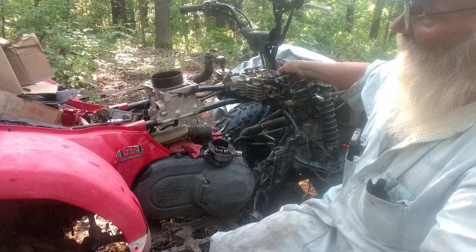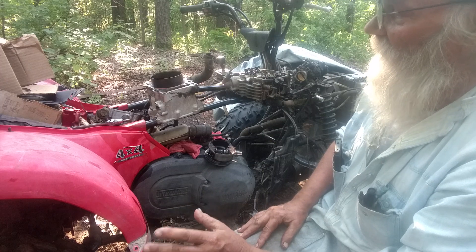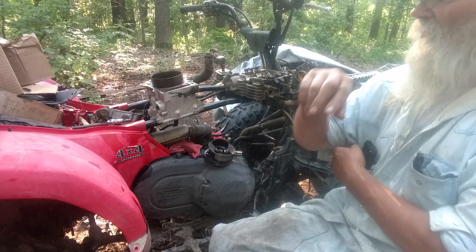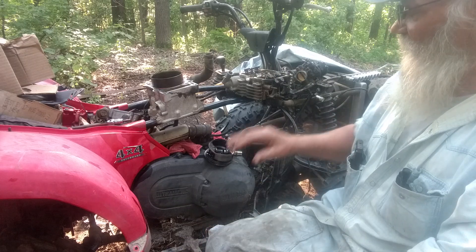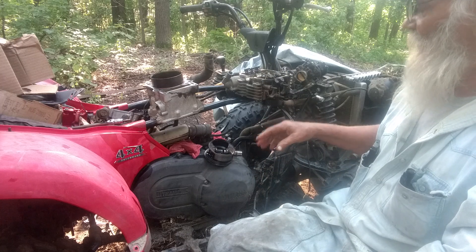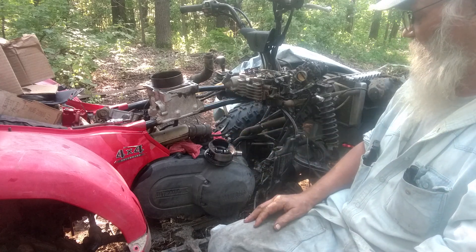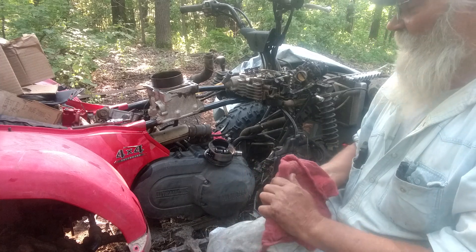The adjusters were set on the tight side. Now I can see owning one of these would be an expensive proposition for a normal person, and I think that's why a lot of these don't get regular maintenance done. I really don't know what they would charge to set the valves, because they've got this motor so buried in there you have to take a heck of a lot of stuff off — all plastic — to get to the point where you can actually adjust the valves. And even then the exhaust valves are way back under — it's all touchy-feely kind of stuff. She's not designed for easy maintenance.